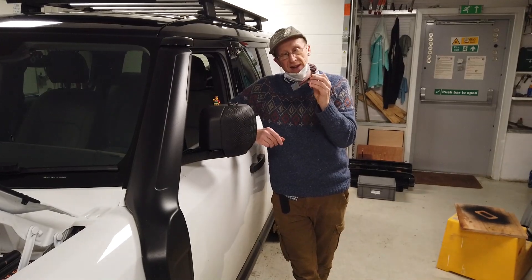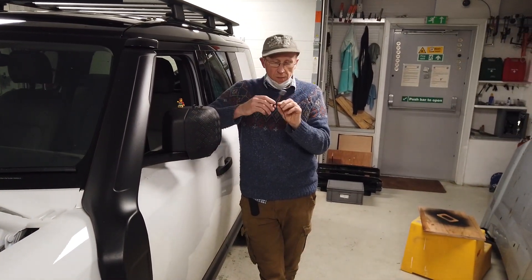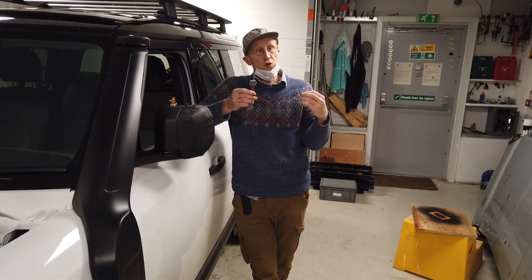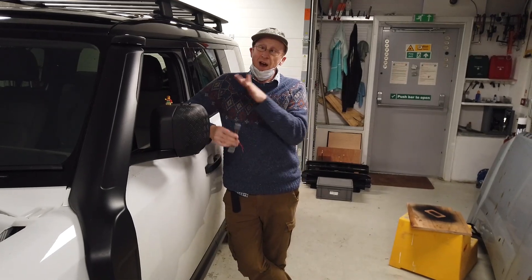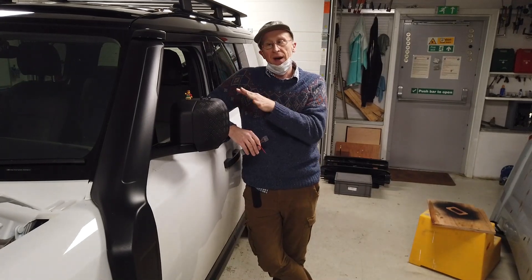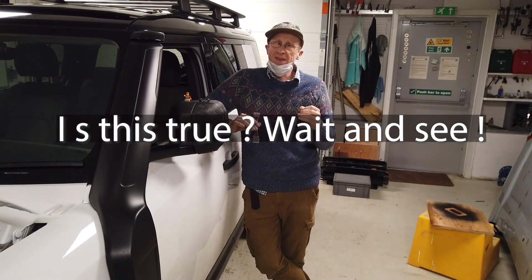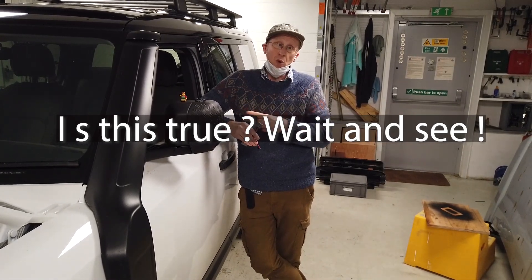We are going to plug in our little interposer loom into the overhead socket, connect these wires in, and go out for a drive and see what the voltage is. Now, the other thing we need to look at is — I thought originally that was battery voltage and I thought it stayed there permanently. But after you turn the car off, after about 20 minutes, it seems to go into a power save mode and cut the power to the overhead console.